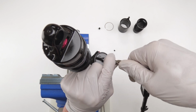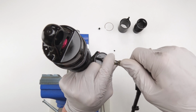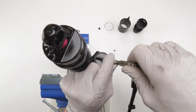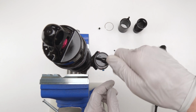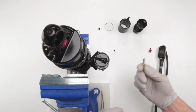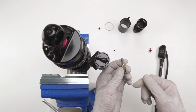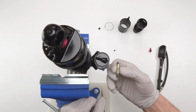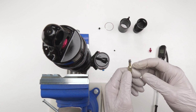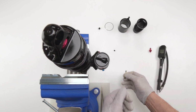Technically, I should be able to remove from this side and not lose any air. Look at that. Now the big question is, when I remove this guy now, will we lose air? We shouldn't. There we go. Guys, the Race Tech adapter works. I will put the link in the description. I want to use it with the nitrogen system as well to see if that one works, because I had asked those Power Tank guys to see if they could build something basically identical to this.